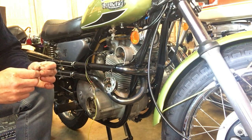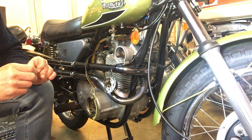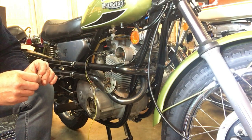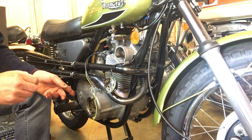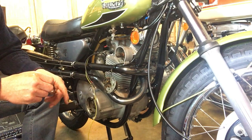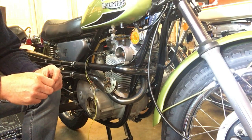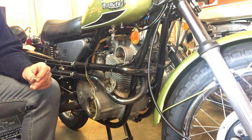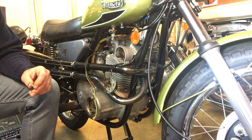So anyway, I've managed to dress up the original, the slot in it, so at least it should move with a screwdriver now, and we'll put these points back together and we'll start again. But it should be pretty quick, as we know that the marks on the rotor are accurate, so we can just line that up using the ratchet. So we'll get it back onto fast forward and do a time lapse, and hopefully we'll finish this off.